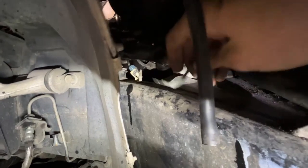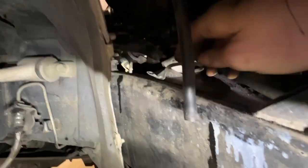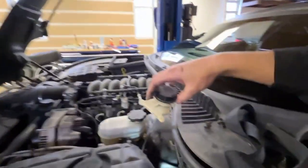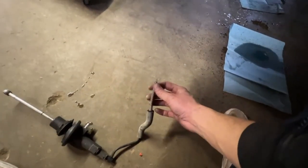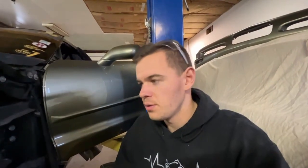This ground was wrapped around it so I couldn't get it off, so I took the ground off and took the reservoir unhooked from that master, because we reuse it on the new one. This was where the quick release was to the slave — where I cut — because we're getting new stuff anyway.